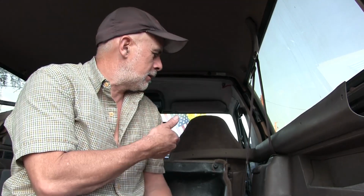I mean, the other truck, the way it's set up right now, will pretty much go anywhere. It's got a Detroit in the rear, okay? That's a pretty hardcore differential. It's like a full-time locker, okay? So it's kind of rough around the streets, but yeah, it works. You don't got to wait for it to kick in. It kicks in all the time. 456 gears, works great with the 4-speed automatic E40D. And the suspension, well, it's got aftermarket springs all the way around. It's got Devers up front and Skyjacker soft ride leafs in the rear. There's no lift blocks on there. I'm thinking, does somebody who buys this truck even need that?